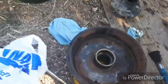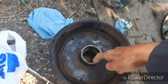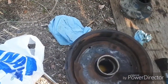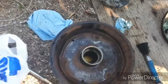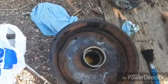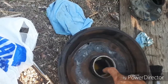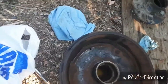especially in these 3,500 pound axles, the inner bore on the hub is machined the same depth all the way through, which means it takes the same outside diameter seal and the same outside diameter bearing on the inner bearing. And most kits I see, they're Chinese made. They're not made by any well-known bearing company, and they're made for a hub that's got a two-step in it. One wider step, the seal's the right size, but then it's got a narrower or smaller machined hole for a smaller bearing, which doesn't fit.